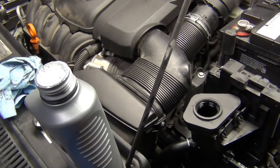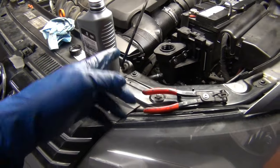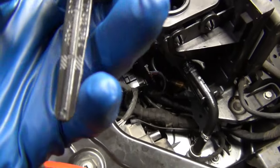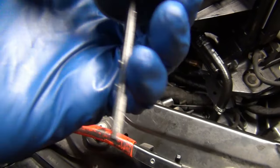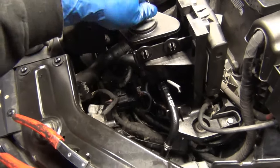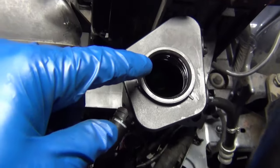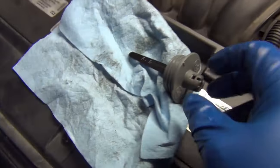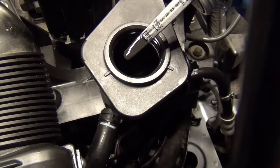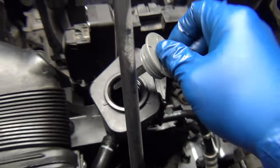So we're going to let it sit for a little bit, let it bubble up. We're going to run the car for five seconds, turn it off, let it sit for a little bit, then run it again. I don't think we have to turn it lock to lock like you do if you do a rack, but you just have to get all the air purged out. When you're filling this up, check your dipstick — you want to be between the min and the max. There's a shaded area that's ideal with the cap screwed all the way in. You've got to screw it all the way down and then all the way back out to check the fluid — do that and you'll be okay. A fun life hack to eyeball where you're at: if you're just over the filter tower, that'll get you to about the minimum. That's your goal.